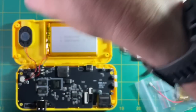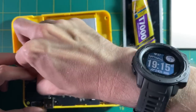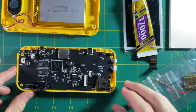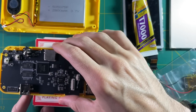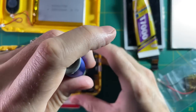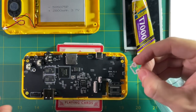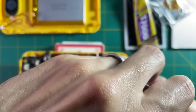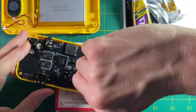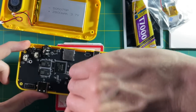Remove all your shoulder buttons and put them to the side. Then you can unlatch the speaker cable as well as the battery cable — they're kind of tight in there, so just pull them out gently. There are two screws holding in the logic board, so take those out. Don't forget your reset and power buttons as well. Next, remove the analog stick — just two screws — and there's a little ribbon cable you unlatch and pull out. Same thing with the ribbon cable for the display.